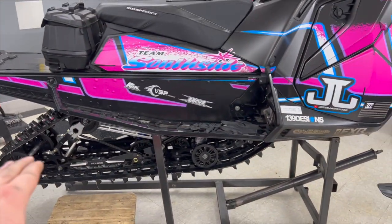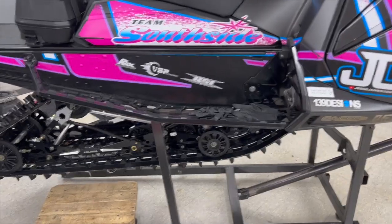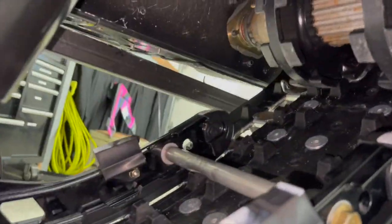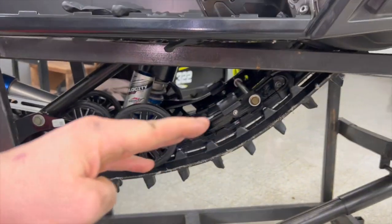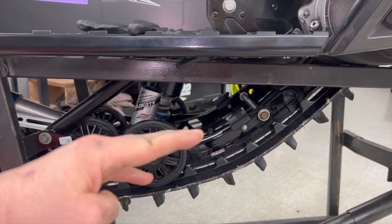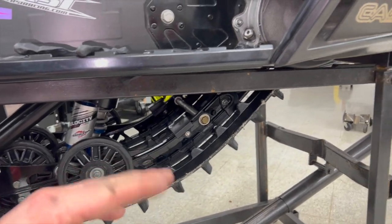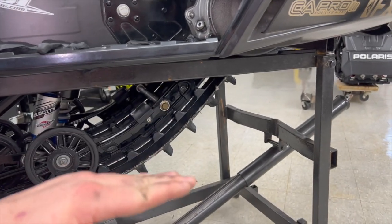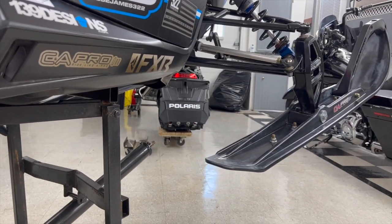Your rear skid is bolted into your suspension — that's a fixed location. Your suspension, your rear skid, works underneath that and kind of floats around. What the limiter strap does — and I took mine out — is it goes from this crossbar right here up to your torque arm. It actually bolts to the other side but goes to your torque arm. This limiter strap limits how far the front of the suspension is going to come out, limiting how much droop comes out. What we're feeling is when coming out of a corner, it's letting the suspension droop too far and picking that inside ski up.